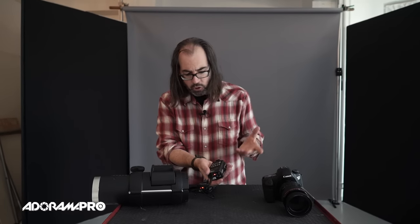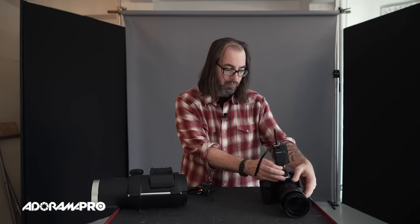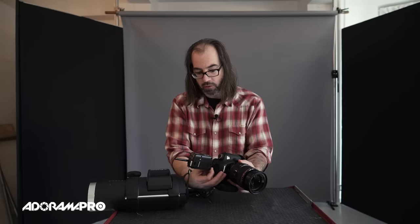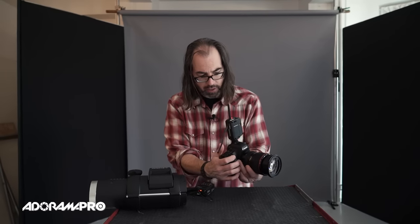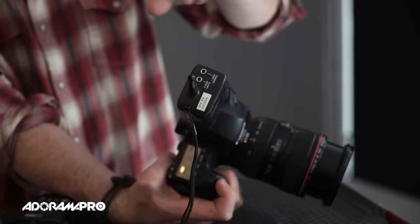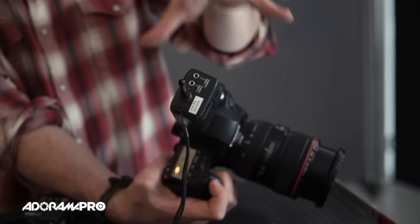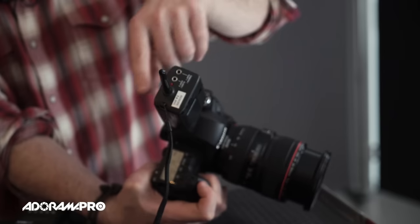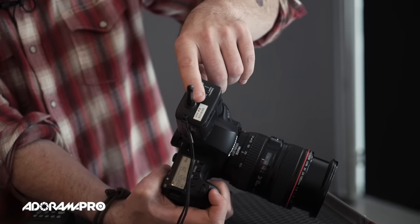The only other place it could be is the connection between my camera and my transmitter, which could be a sync cord in some cases, but in this case it would just be on the top of the camera on the hot shoe. Sometimes if the radio is too loose or too tight you'll have problems, so you want to snug it down — not going to fall off, but not too much. Then just take your camera and take a random shot. That works. Also notice that when I fire the camera, this lights up. So if I'm not near my flash unit, I can just put the transmitter on top of my camera, press the button, and this should light up — meaning the camera is making the transmitter work.